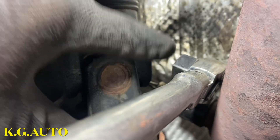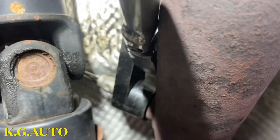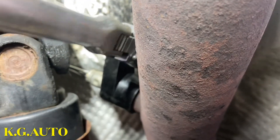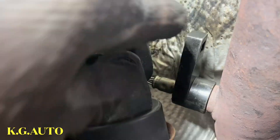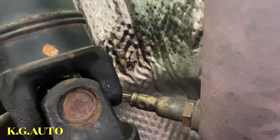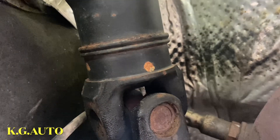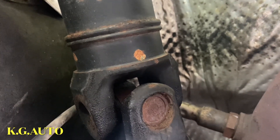What is good about this oxygen sensor socket is you can put it on top to break it loose, or you can put it at the bottom — so the hose can go up or down either way. I got the guy out because it was in a tight spot there. But once you have the right socket, you should be fine. Break it loose already. It wasn't that difficult. You just have to have the right socket. I believe you can use a 22mm flat.